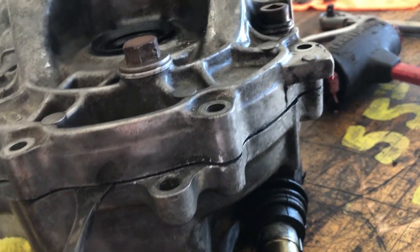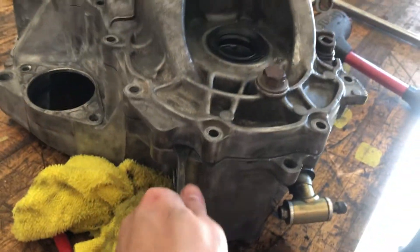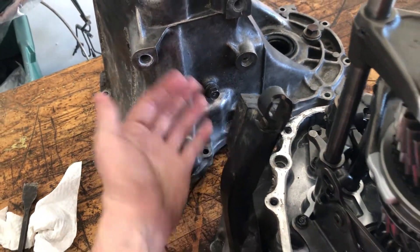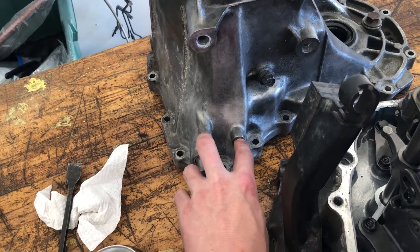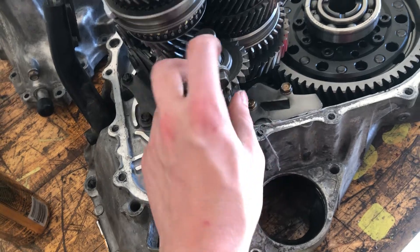Get a bit of a crack going in there. Be careful with tools like this because you really don't want to scratch it up. It's on the outside so it doesn't matter as much, but you really don't want to gouge the surface where the two halves mate. Here it is in all its beauty. I missed one bolt — just one — on the top of the case. Standing over the engine bay looking down, right across from your clutch cable bracket, there's a 14-millimeter bolt. That was the one holding it up.